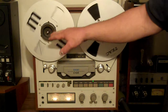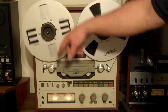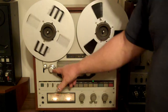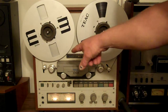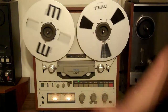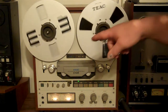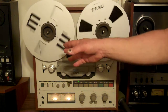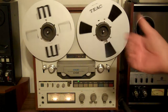To recap: when you start the tape, it's all set to zeros. On the inside you have a piece of sensing foil mounted on the outside of the tape, and once it comes across this post — it's about an inch long right here — it senses it and fires the tape off the other way. This will continue to play the entire way until, if I have it set right, when it reaches all zeros it'll stop, reverse play, change direction, and then go forward.